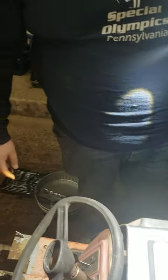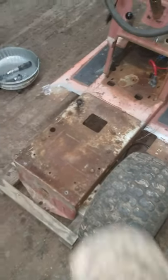I'm thinking gas pedal all the way. We're gonna need to make some custom fenders because the tires are gonna be up in here. The tires we have are nice knobby like four-wheeler tires. We're keeping the original trans-axle if we can, but the tires are gonna sit up in here, so we're definitely gonna need to extend a fender from over here. We might raise the seat a little bit too.